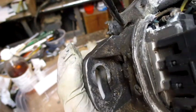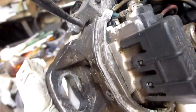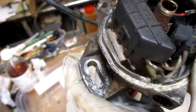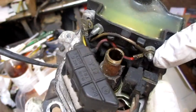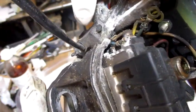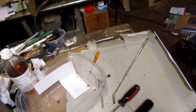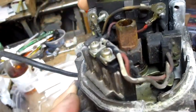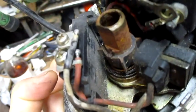The yellow wire comes from this control unit here. So yellow wire and blue wire go here; red wire from the control unit goes to here, and the brown wire from here. Move the cap from the igniter to see how the wires are going.